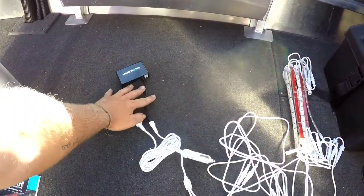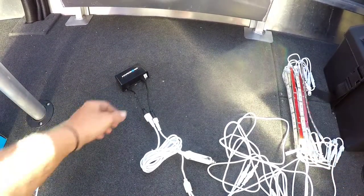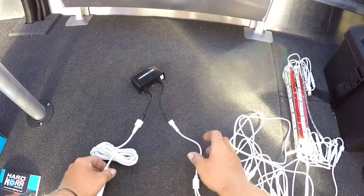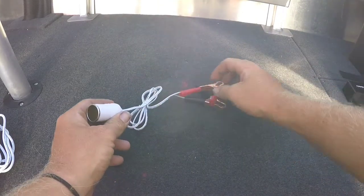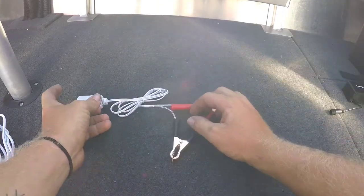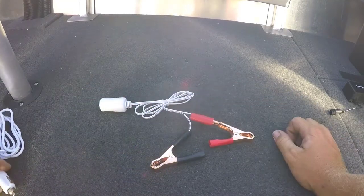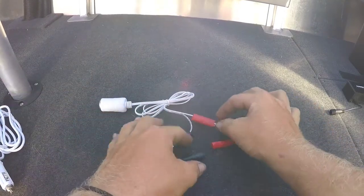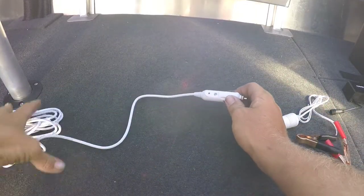So we've got the box — this is what your remote tells the lights to do. You power in, power to your lights. What you're going to want to do is grab this little cigarette socket side, and this is the one you're going to want to chop — get rid of these little terminal clamps and put your connectors onto these two.